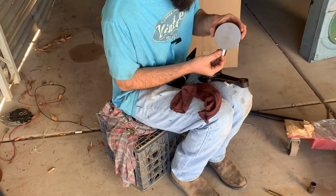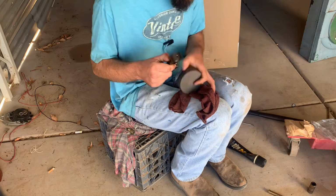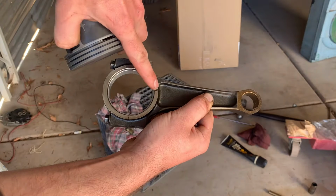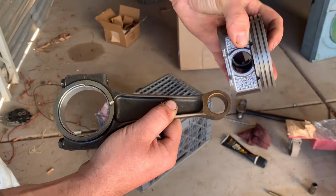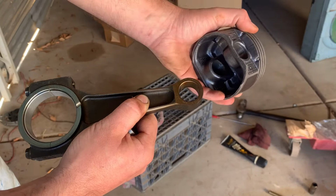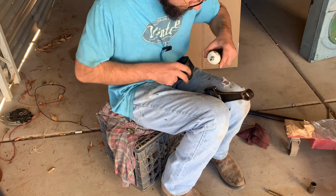We got a new shaft with it, so we'll use the new shaft, I guess. I remember that you have to be very careful when you're assembling these. What I remember when I took it apart was this notch was at the front. So if you look, front marked F, this is how it goes together. Because you could put it together either way and it will go together, but you have to put it together directionally. I'm going to use some assembly lube just for good measure.